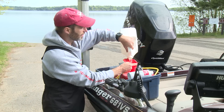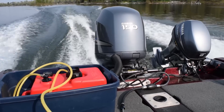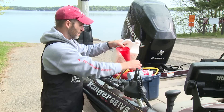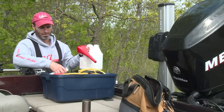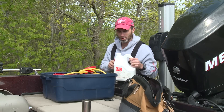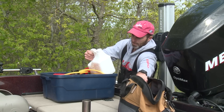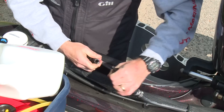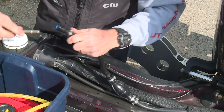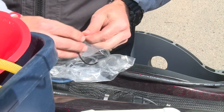Another high concentration application uses accessory fuel tanks used by small engine and marine mechanics to diagnose and overcome fuel system problems. I'm going to run this two-stroke direct injection on a mixture of one gallon of Seafoam motor treatment mixed with a gallon of fresh fuel. Whether dealing with heavier engine residues and deposits, a rough running engine, or bad tank fuel, simply change out the fuel lines to run the engine off the small tank mixture.